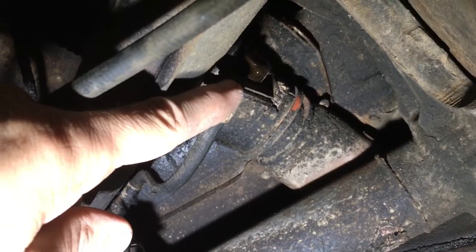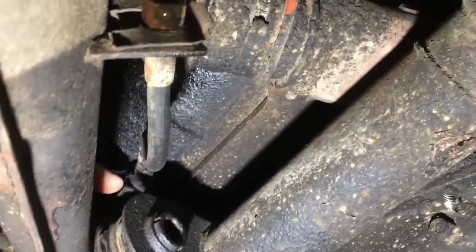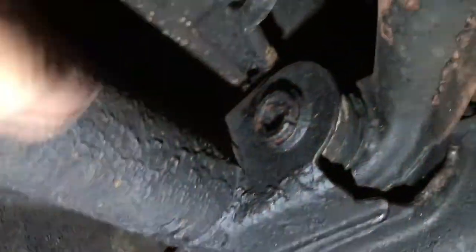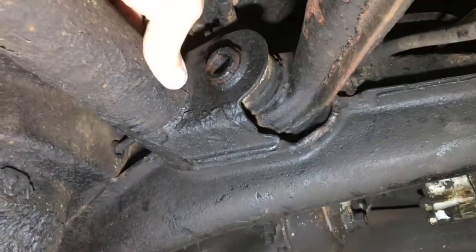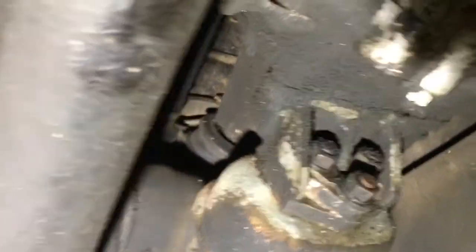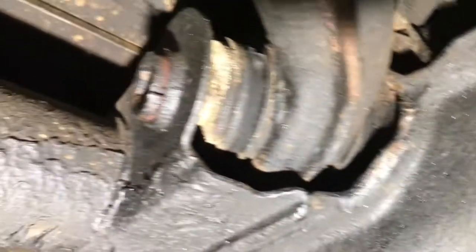I did find some brake fluid on the right rear, so the rubber line is going to have to come out. There's a little junction block right there that's bolted in, and then that turns to the metal line — it runs across to another T that ties in where the rear line comes in, the other one crosses over, and the rubber line connects there. All that's going to come out. It would be really easy with the transmission out and the body lifted, but it may just be a little difficult.